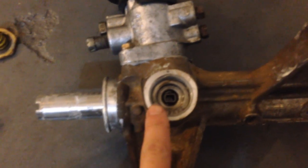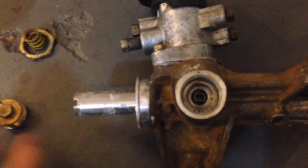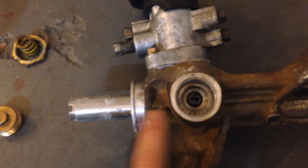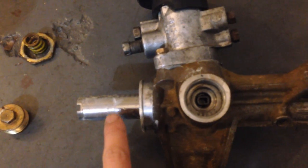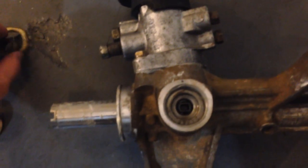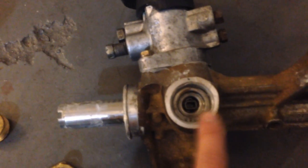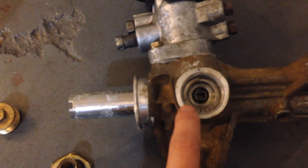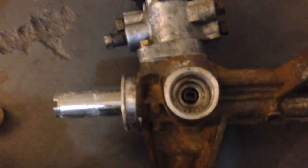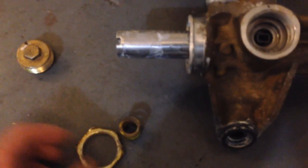This right here is the guide bolt. This is used to adjust the play and the stiffness in the steering rack. It puts tension on the rack gear and makes it stiff. So if you have play in your steering rack, this is the most likely cause, because it should be adjusted periodically. It states so in the service manual. There's 3 pieces for that. Just put it back in reverse order. The spring goes first.